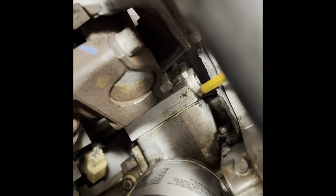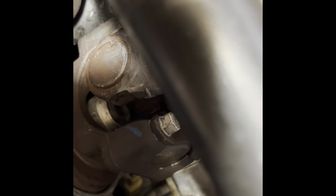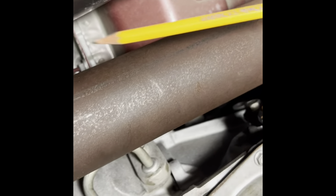Right here you're going to see the drive shaft because it's an all-wheel drive vehicle, but four-wheel drive has it also. I'm not sure if models without this shaft have this oil cooler line or just a block-off plate. But if you do have this drive shaft, you're going to have to take it off. These are 11 millimeter bolts, four of them all the way around, and you'll probably need a three or four inch extender to reach back there.